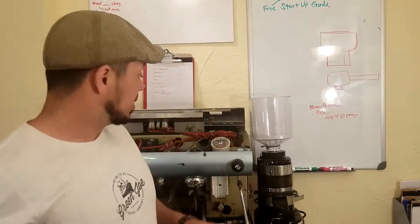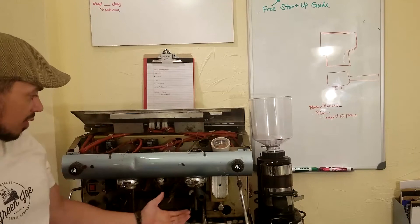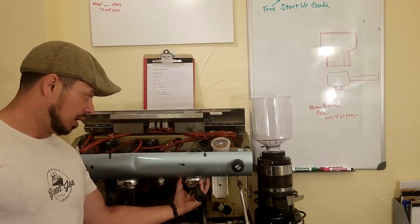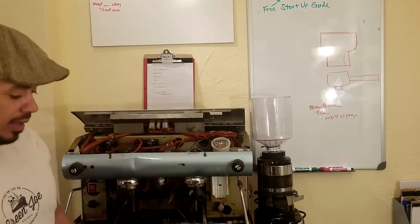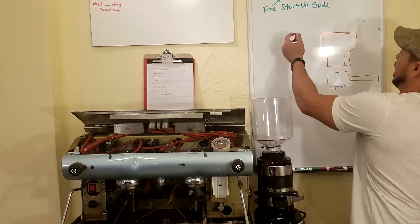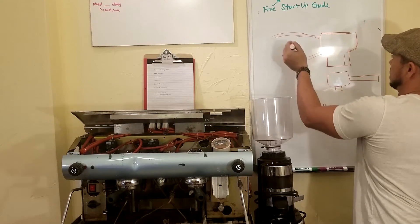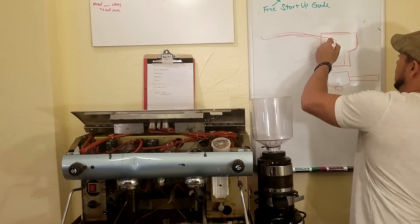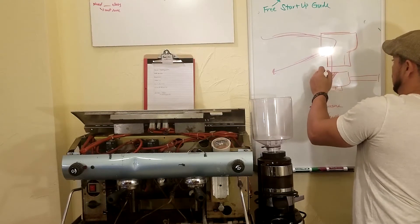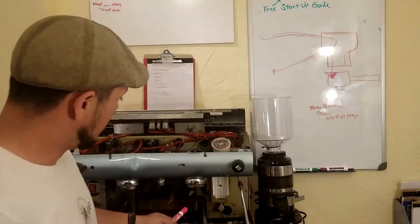I want to talk a little bit about how the group head works. This is the group head — it's this big bell that comes running out of the boiler. And this is the portafilter — the handle and piece that you put onto the group head in order to draw your shot. What's interesting about the group head is essentially it runs hot water from the boiler through the group head and draws it back out. There's a tube that goes into the group head and a tube that runs out — the hot boiling water comes in, heats the group head, and then goes out again. Through conductive heat it transfers that heat onto the portafilter, so it maintains temperature on both the group head and the portafilter.